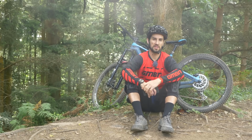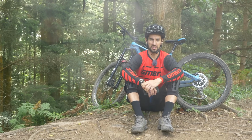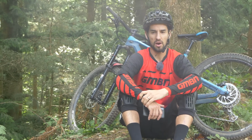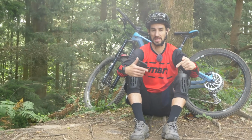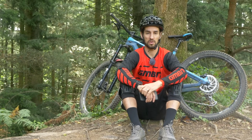So definitely in winter, when I'm riding in lots of wet conditions and washing my bike a lot, it's a nice idea to take your bottom bracket out occasionally and just check inside your bike, see if it's filling up with water. Also, I quite like to run a full cable from my shifters to rear mech, so then water just can't get into the cable quite so easily. And that means your gear cable just lasts that little bit longer.